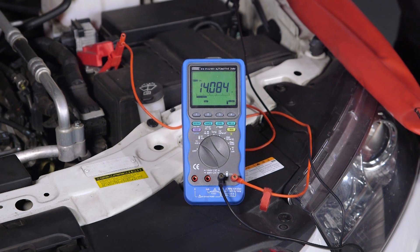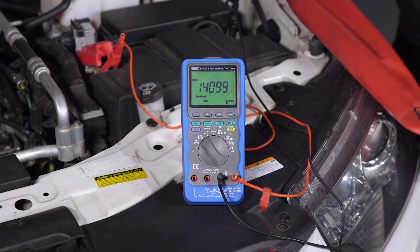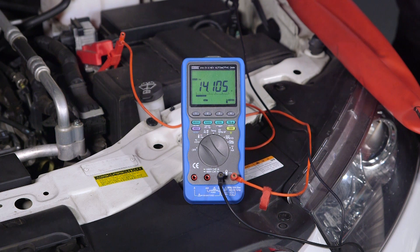The diagnostics for these codes will run only when the engine is running and the battery level is greater than 11 volts. A P0192 will be recorded if the sensor signal voltage is lower than a predetermined value.